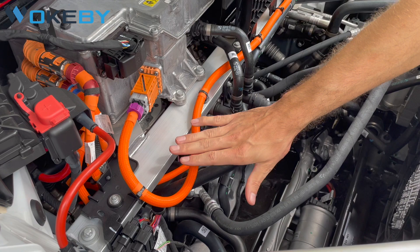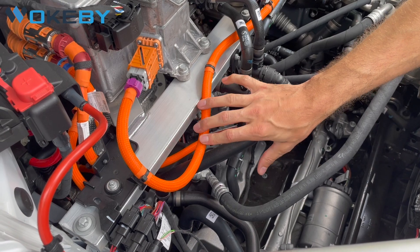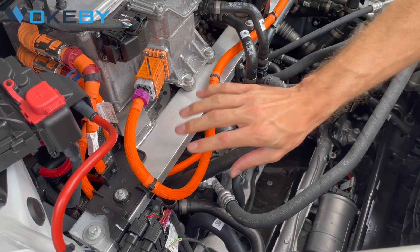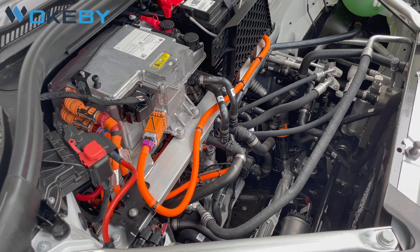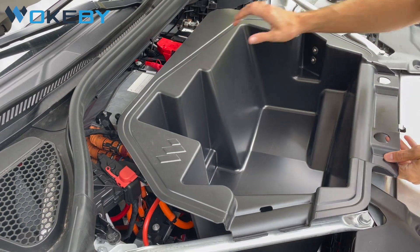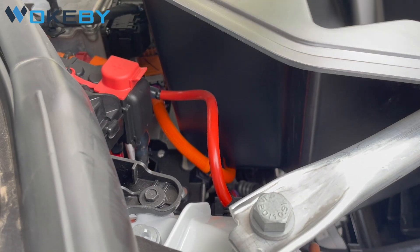This is an important thing. These cables — sometimes it's a little bit tricky because they're always routed a little bit differently when they come from the factory. But usually you don't have to cut one of these cable holders. Just move it a little bit so that it fits. Always install the frunk at the front first until it rests down in the back and doesn't sit on top of the cable.